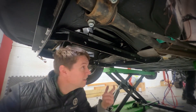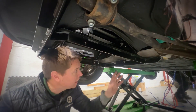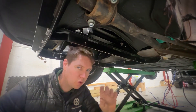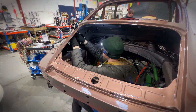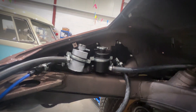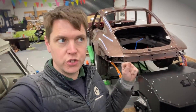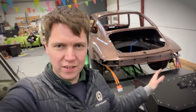The front battery box is now in and double checked — just fastening up the four bolts on the bottom. The frame we've created to mount this in is picking up off original mounting points from the Porsche. We haven't drilled or modified the Porsche at all; this is all bolted, which is really important. Josh has also put in the battery coolant, drive unit coolant, and the charging VCU system into their wing — again, all picking off original bolt holes, with all coolant pipes in and out of the way.